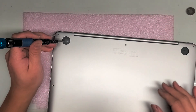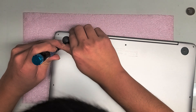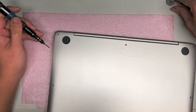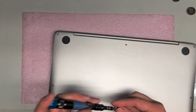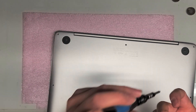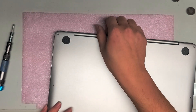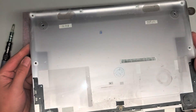The way I get it out with lower risk of damaging things is I get alongside the screw and push sideways — instead of prying it up, I push the screwdriver sideways and slowly peel it up. Alright, now we've got that out. We'll switch to a PH1 screwdriver and remove these two screws. I always use the JIS type screwdrivers because they don't skip out of the holes. So let's continue lifting this cover up — and there we go, we've got the cover off.